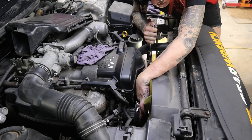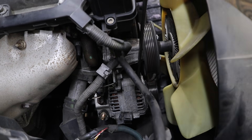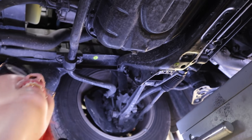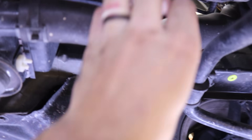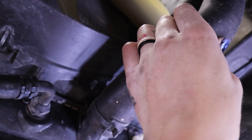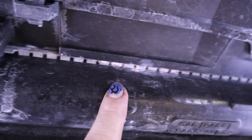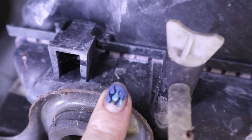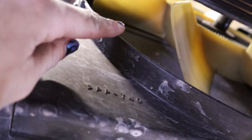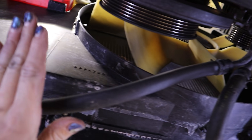Since we're doing a full inspection of this vehicle anyway, that includes putting the vehicle up in the air and checking all the hoses. It's a little squishy actually. And it's a good thing I did — because look, we can also see that we've got some crusties forming here on the radiator. This is very common — see those pink crusties? This radiator is failing. You can also see the pink there on the radiator fins, so this is definitely something that's going to have to be replaced. I'll take some pictures for the customer.